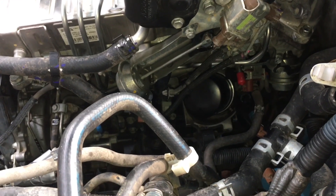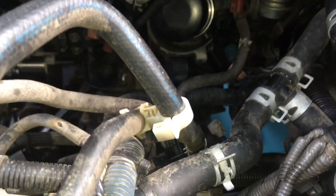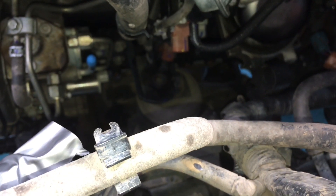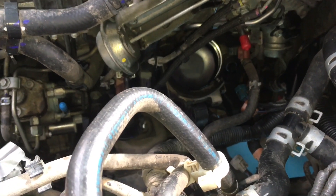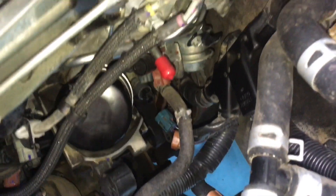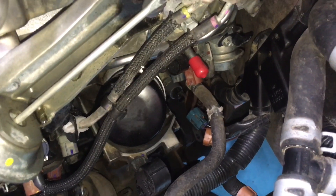This is how I do one side: when I tilt it upwards here, you've got to make sure that side doesn't kick out. As soon as that's over the engine mount and in the hole, I'm in. So push back — you need the whole crane to go back really. The top EGR valve is getting around the wiring loom at the top too, so the top's not going to go in more until it goes down.